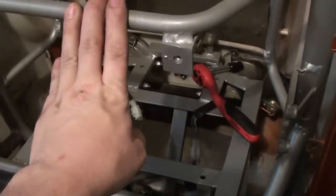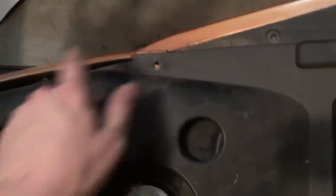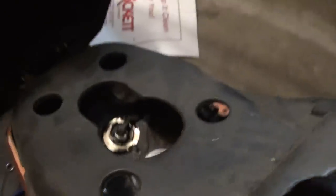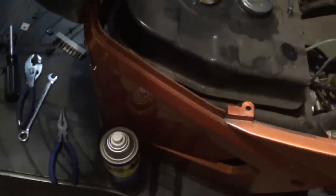With the back plate removed — that took four 10mm bolts and eight screws, four on each side — this pulls up. Wiggle a little to get around the hinge, and there we go. Now that's exposed. We can start pulling the back plastic outer sections off. I'm going to start with the top pillar here, then go to the tail light assembly, and then everything else should come off around it to work our way to the front, to the battery cover. Then we should be able to pull the floorboard off and then the front nose section.